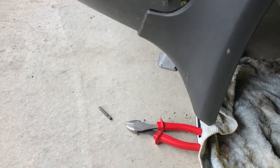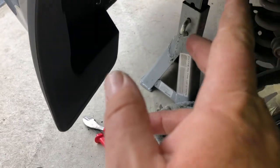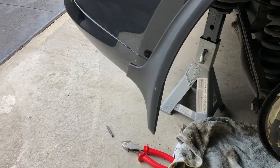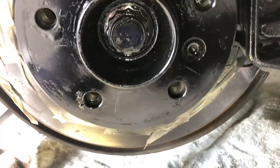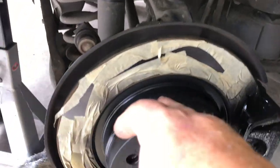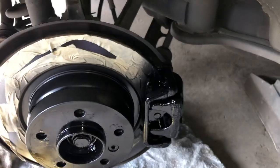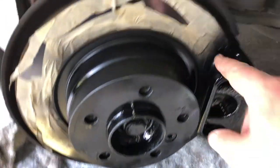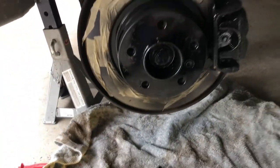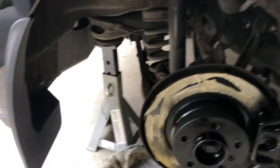The mud flap is fitted. It came with screws but not enough of them — we'll need to get some more. This is a generic mud flap kit, really cheap, and I really like them — I think they look great, the molded mud flaps. You do have to get some extra accessories for them though. I'll put a link up for fitting these to a one series — I put them on the blue one series, my first project car. Brakes are painted, all that rust is dealt with, and the paint will stop it rusting again. Used masking tape on the inside edge so we didn't spray the disc. The caliper is all done, looking good. We'll let it dry, put the wheel back on, and do that four times over.